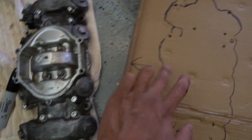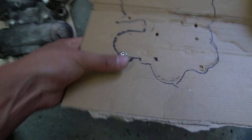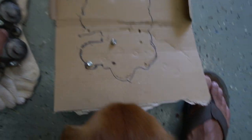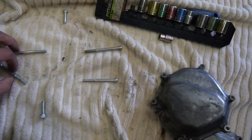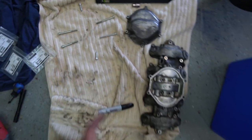I got the outline of the valve cover here - this is the front side. With the holes I created for the bolts, I just push them through the cardboard while I clean the valve cover so I don't lose track of which bolt goes where. The upper cover is nice and simple - it's just got four same-size long bolts on the left and right, and two short ones on the upper and lower side. Nothing crazy, so I didn't bother using the cardboard layout method for that.